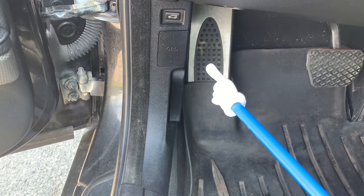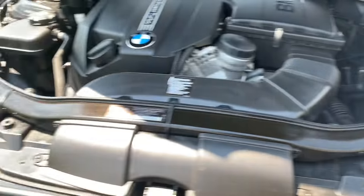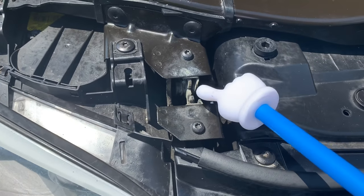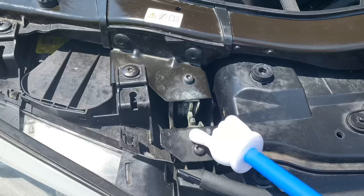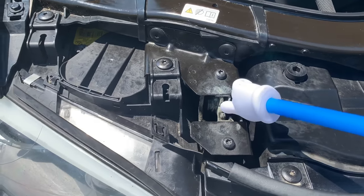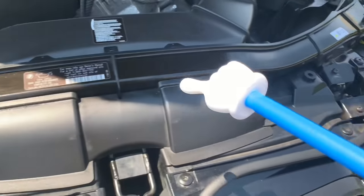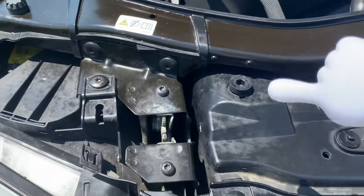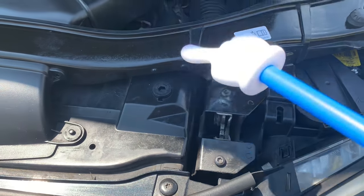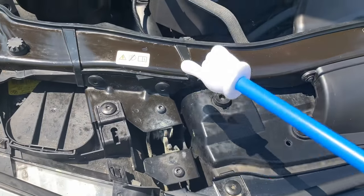On my other BMW I spent about $150 replacing the whole thing. The problem wasn't in the lines at all — those were fine. I believe the problem was these locks: they got dull or corroded and lost tension, and weren't able to open properly. The book says these locks need to be lubed with motor oil. I used white lithium grease and I've never had a problem with this newer BMW. Use white lithium grease right in the locks and problem solved. Make sure your locks are properly lubed with motor oil, white lithium grease, or similar — to prevent your hood from getting stuck.